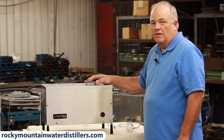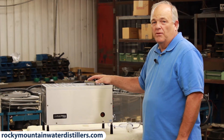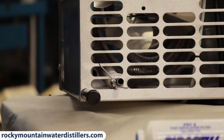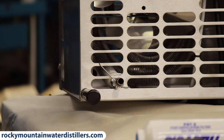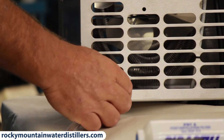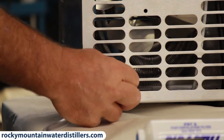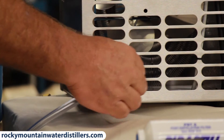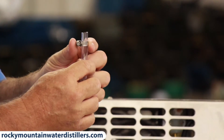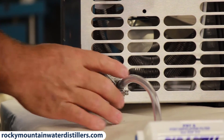Once your 30H is assembled and you've seen the video on how to assemble it, this is what it should look like. I'm going to show you how to put the water hook assembly on for your bottle. This right here is where the distilled water comes out, so you put your tube hook to that. It fits tight — you push it over the top of the stainless steel pipe and wiggle it around in a circle until it goes up about a half an inch. Then slide your clamp over the top of your hose and tighten that up with a screwdriver so it doesn't come off.